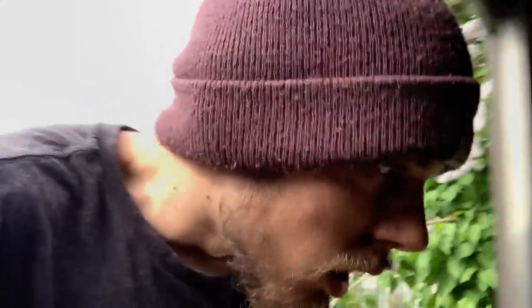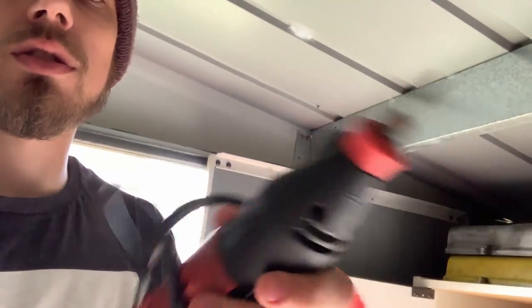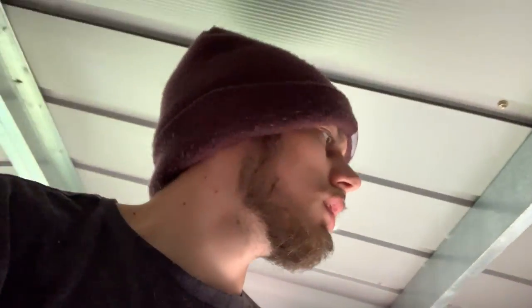We managed to get some headlights and turn signals working. Turn signals were pretty easy. For the headlights, I used this Dremel to shave off one of the little nubs on the turn signal bulb itself — shaved it down a little and it fit right in. I'll show you what I'm talking about. I also got the headlight bulbs and they fit right in.